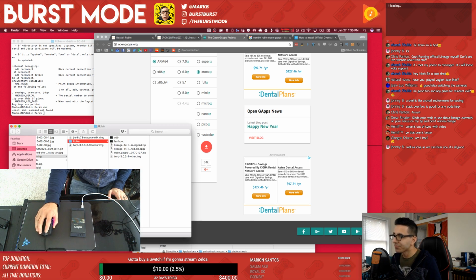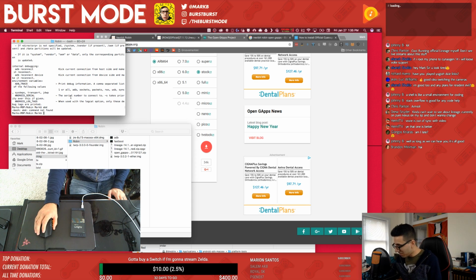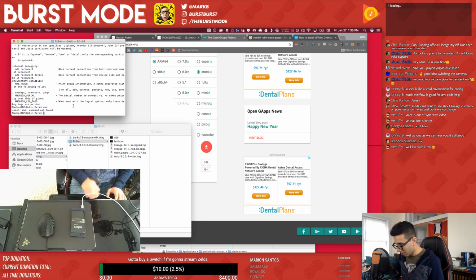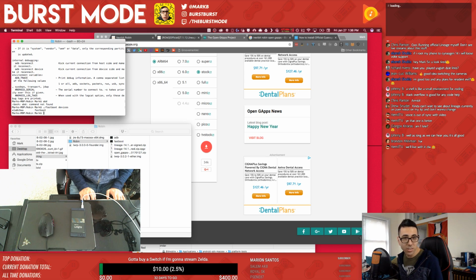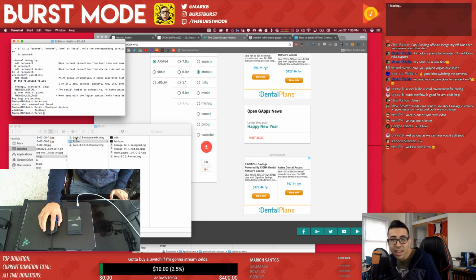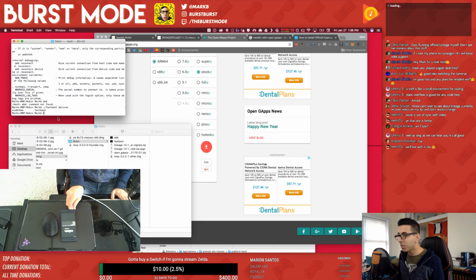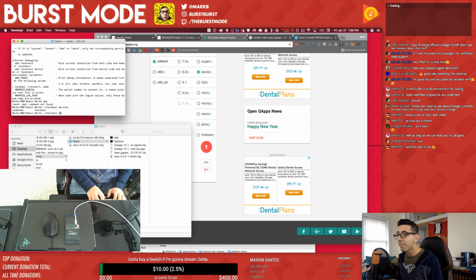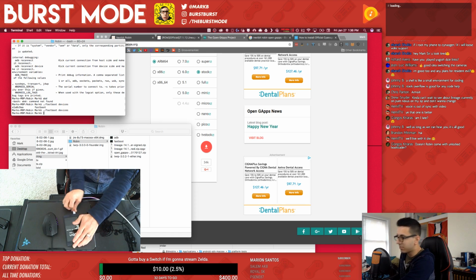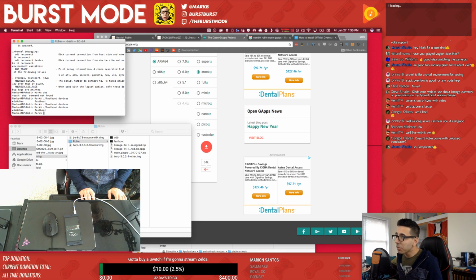Okay, so the first thing that we're going to need to do is unlock this bootloader, because this bootloader has not yet been unlocked. We want to make sure that the device can see, or our computer can see our device. So let's go ahead and run fastboot devices. Excellent. So our computer can see one device. That's this one right here, E1A8C9AA. That's this Robin right here. So if we unplug this and we run fastboot devices again, nothing. Zip, zero, zilch, right? So now that we know we can see the device, that's great news.